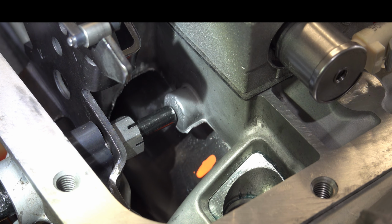Anyway, what I'm going to do is take off the second gear servo housing O-ring and the O-ring here on the inboard side. This is normally a scarf cut seal, but I'm using a Viton kit. It doesn't really matter either way; these seal marginally a little bit better. But regardless, you don't want to have this seal or this seal on, and you don't want to put the cover seal back on either. So we'll get rid of that. You could leave this inner seal on. That's not going to interfere with anything. But having these other O-rings off makes this a little bit easier.